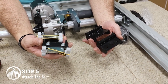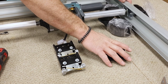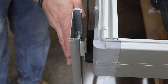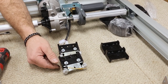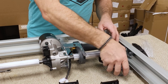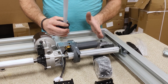With the motor shaft attached to the bed, we can move on and install the belt brackets. These brackets guide the straps that lift and lower the bed. There are two types of brackets: the basic version, which simply guides the straps, and the stabilizer guide bracket. This bracket is placed inside the guide rails that will be installed onto the walls of your van. Let's start by installing the stabilizer guide brackets. The stabilizer guide brackets are usually placed on the side of the bed closest to the motor, but ultimately this is up to you and can be changed. Before we install these guides, choose where you want your straps to sit on your bed.